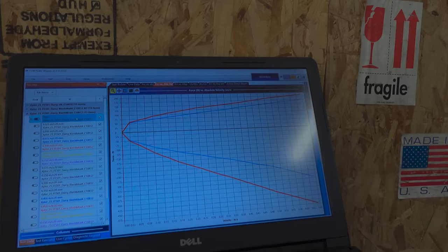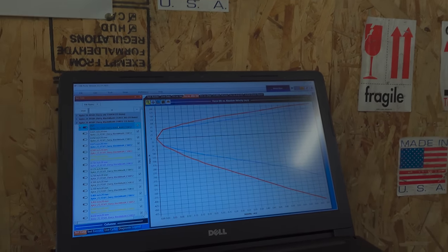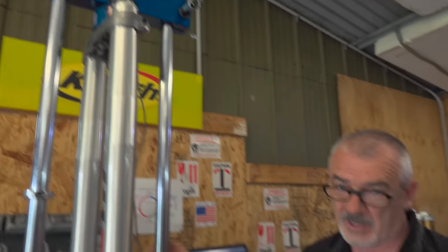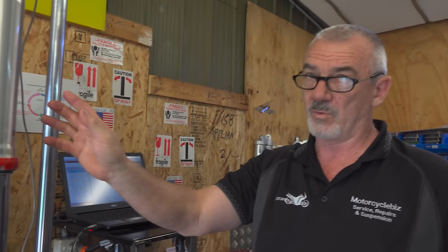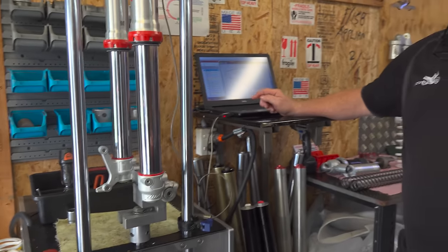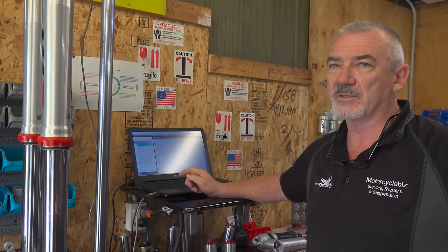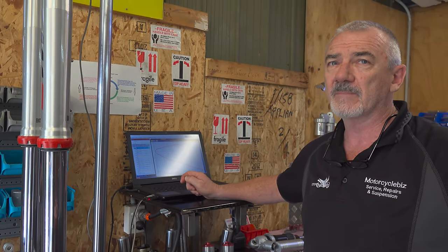And so I can still alter that now because I've got the different adjustment. Yeah, you've got compression adjustment on the bottom of both and rebound adjustment on the top of both. And the dampening is symmetrical and equal between the two forks. So if I'm hunting a bit more trail feel after we do this, then I just progressively work on that with a couple of adjustments. Couple of clicks one way, couple of clicks the other way, and see which way makes the improvement. Just chasing that final fine tuning that you're looking for.